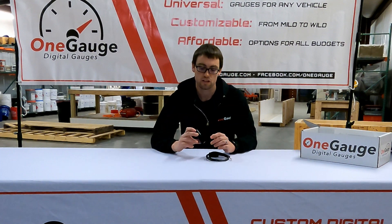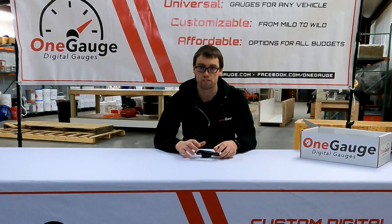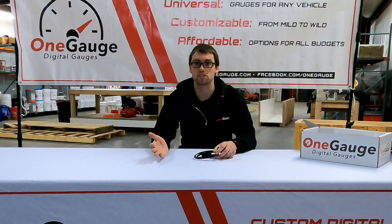OBD2 is a system that was created to monitor emissions back in the mid-90s. In the United States, OBD2 was implemented on all vehicles made in 1996 and later. There was a big change in the early 2000s, between 2005 and 2008, where the OBD2 setup was upgraded and it communicates much more quickly. All vehicles made in 2008 or after have the faster communication setup.